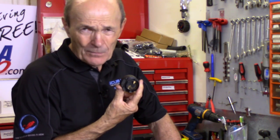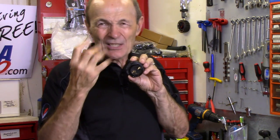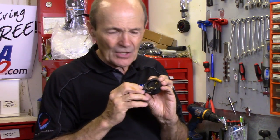Take it out again, shake all that water out. There's very little else you can do unless you have some drying agent. Some people say rice — a lot of people use rice, like when your cell phone falls into water. Rice can't hurt; it acts like a desiccant and sucks water out. Put it in the sun. Can't hurt at this point. Keep it on the back, not on the screen — sunlight can ruin the LCD screen. So on the back, in the sun, you've got to get it dry.